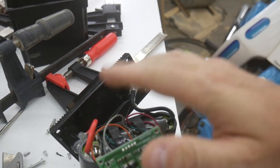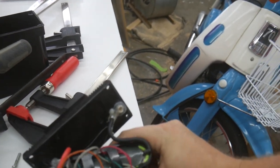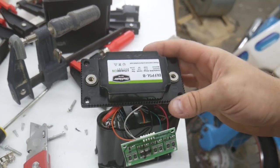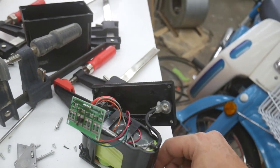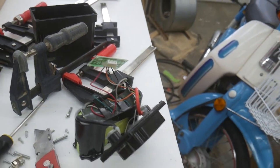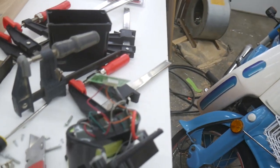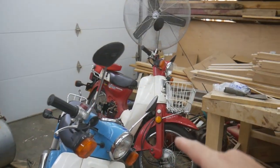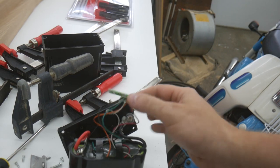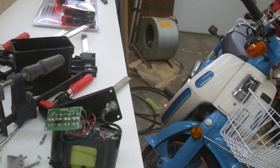The cells might be good — I might try slapping a charger directly on them to see if they'll hold a charge — but the control board is fried and I'm not going to put something like this back in those scooters because they'll just heat them up until they explode. A replacement battery for me is only about eighteen dollars, so it's not a big deal. I'll go back to the old sealed lead-acid gel batteries, which seem to handle the higher charging voltage these produce at high RPMs just fine. Thanks for watching!